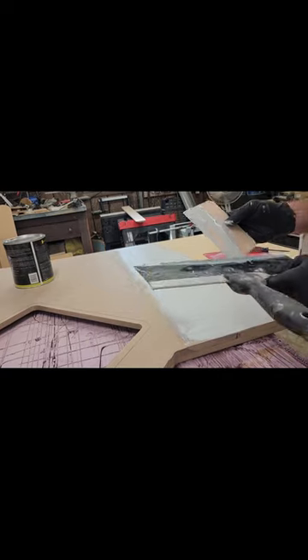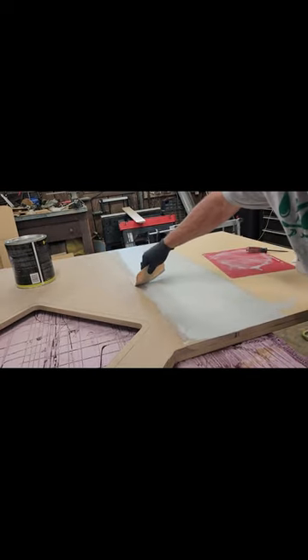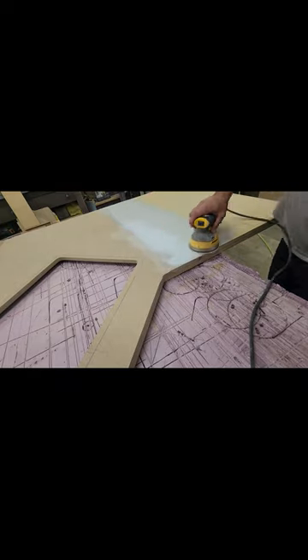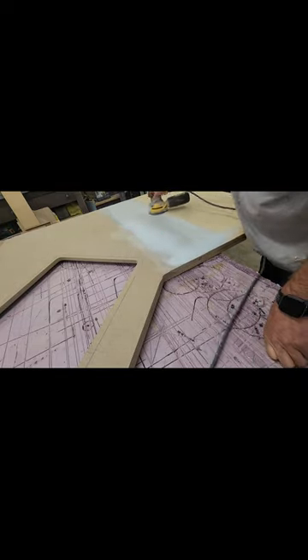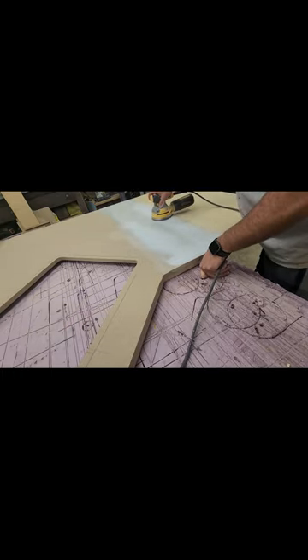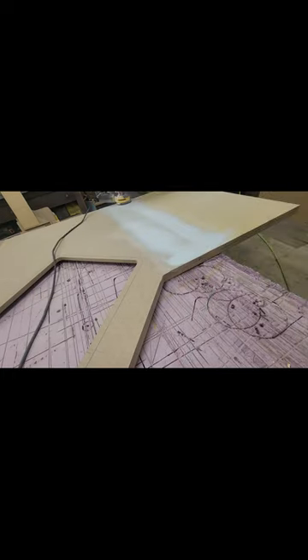If I do need to add a little bit more, I still need to bondo my edges. So if I find low spots when putting bondo on my edges, I'll be able to fill those in. Now that the bondo has dried, it's time to start sanding. I put 80-grit on my orbital sander to knock down that initial layer. For those of you who have sanded bondo, you know there's kind of a skim coat on the top that will tend to clog up your sandpaper. So I'm using 80-grit to knock down the highs and also to knock down that initial skim coat on top of the bondo.